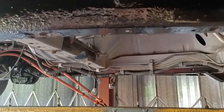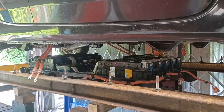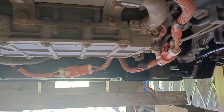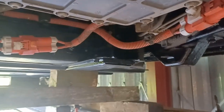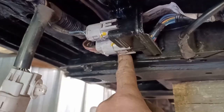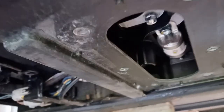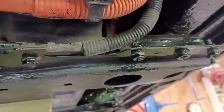Let's put the pack back up into the car and loosely connect it. I've left the lid off because I'm expecting to have the pack down again — this is just going up for testing. I've done the two big orange connectors at the front but haven't bolted anything into the chassis. On the UK driver's side I've attached all the small connections and connected the CHAdeMO cable, but haven't put the CHAdeMO cables into the battery box as I'm not planning to charge via CHAdeMO. On the passenger side I've connected the two high-voltage orange terminals and the earth lead to the chassis.